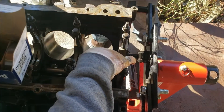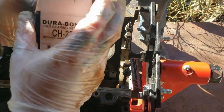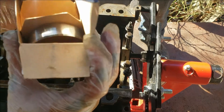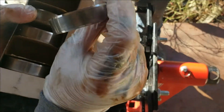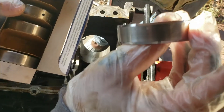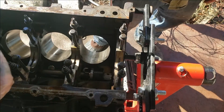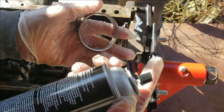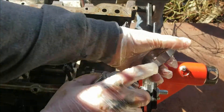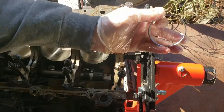This is number five on the bearings. We're going to the kit, looking at 1.5, which is CH 23-1 on the bearings. Each bearing will be marked CH 23-1 — that is the bearing we need. You can take some brake cleaner and clean this off because you don't want to install it with the oils on it. I've seen people just drive these in, but always spray them off with brake cleaner, take a rag or napkin, and wipe them off.